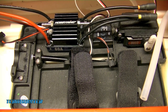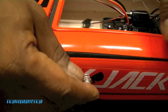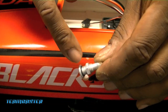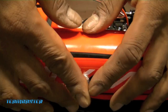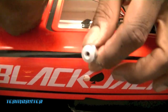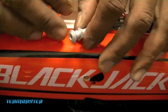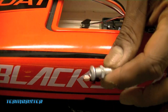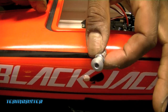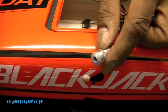Before I do all this, I'll be installing the water outlets - there is one on each side. The existing hole just about fits this outlet, and it goes in there and flush mounts. There's a small rubber gasket behind it that sits flat to keep water out. The screw goes on behind it and gets screwed in tight - there's a little hex so you can tighten it as needed. I'll drill the hole just a hint smaller. The tubing goes on the back over the nib. One outlet goes to the motor and one goes to the ESC.